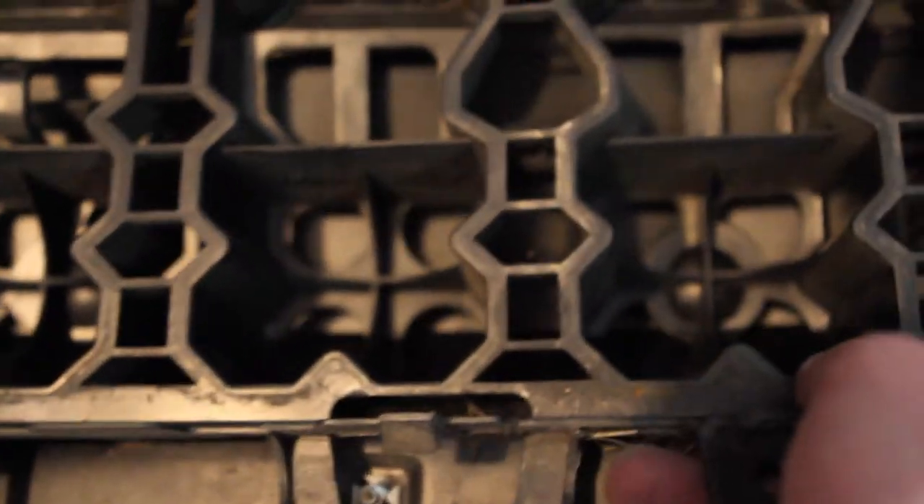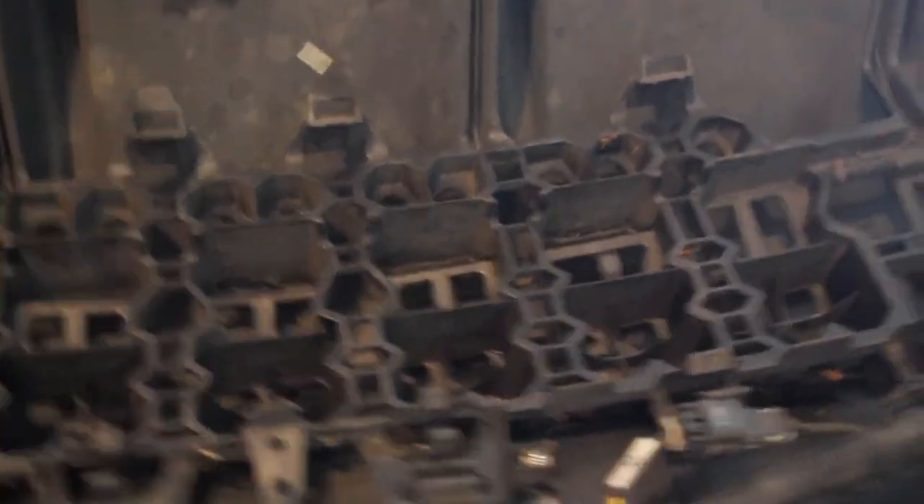So this is the tray again. What we have to do — I found it's best to use a pair of pliers. In here is a tab that you have to pull back and pull up on. While using these guys right here, squish that and pull up at the same time and you're able to get it out. Same goes for this side right there. Then you come to the middle right here and slowly but carefully pull up on it. It'll sound like it's breaking, but just be careful, do it slowly, and it should come out. Still got this guy hooked up right here, so just go slowly, make sure everything is detached, and just like that, pull that off.